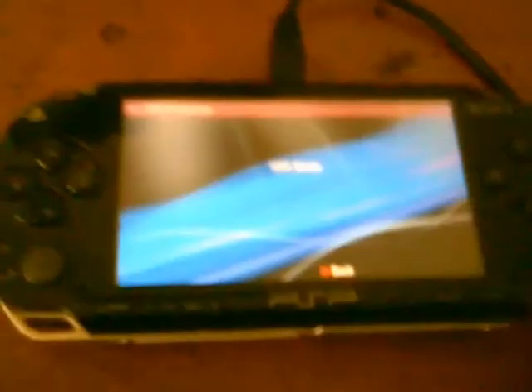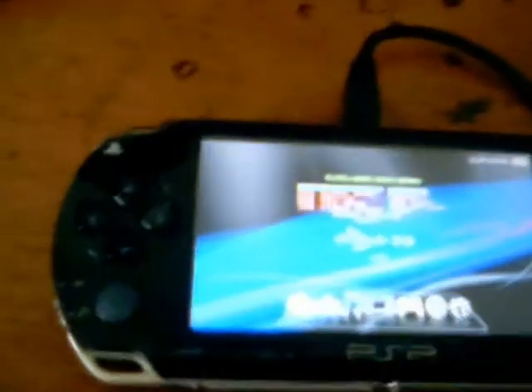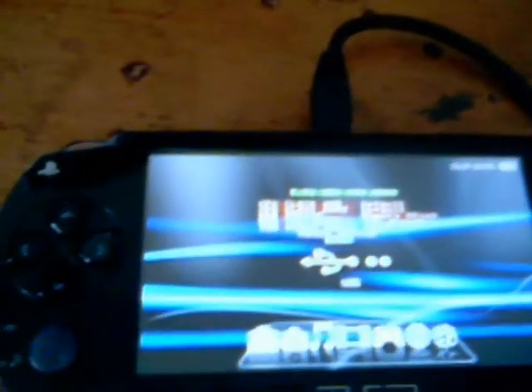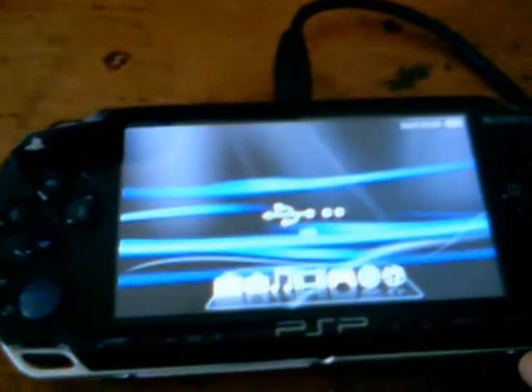If you really want to put it back on your PSP, I'll show you right here. Go back, click the select button, and change the UMD disk on the USB device back to memory stick — back to the way it was. Then go to exit and back onto USB device, so now you're using your memory stick. Continue without saving.